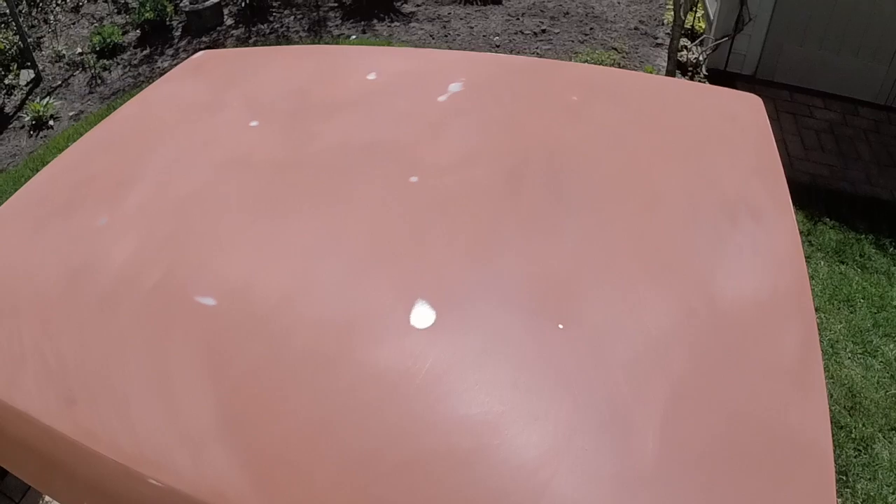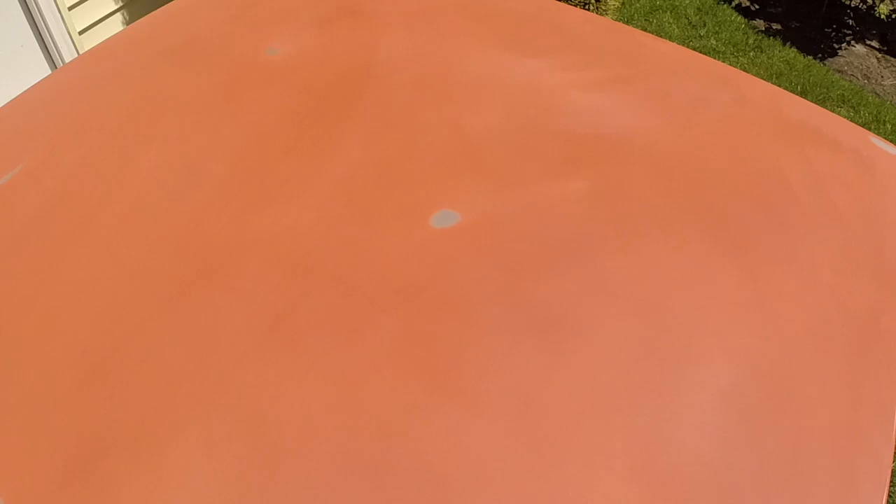So it's all blacked out, and there's three places right here that aren't totally sanded — right there, and there was one other spot right here. So I'm going to just shoot some of the gray sandable primer on those spots. It's not worth re-priming the whole trunk lid for those three little spots.